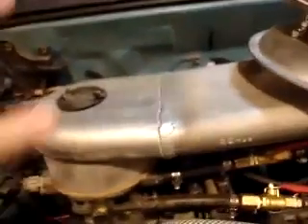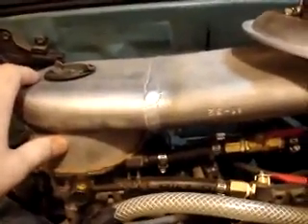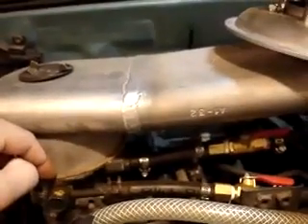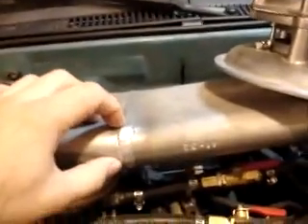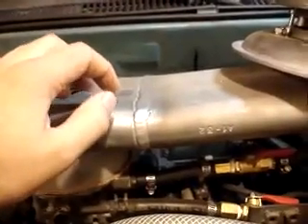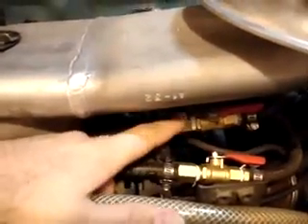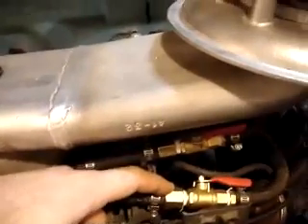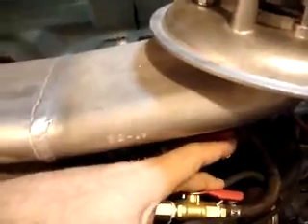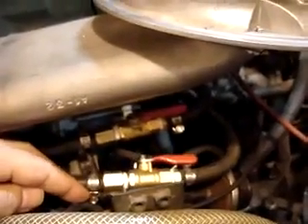Back to our little intake here. When I said previously in the three-part series that you have to cut off the ambient air going into the carburetor — let me clarify. This is not a better way to just inject hydrogen or hydrogen and oxygen into your engine; this is a way to do it so you can cut off the gas completely. Down here are valves to turn the gasoline on and off. When you switch to hydrogen, you turn these off. You get it started on gasoline, and there is a reason for that — it will backfire because there's not enough vacuum pulling the hydrogen in fast enough.